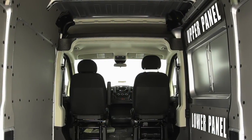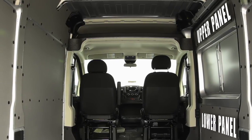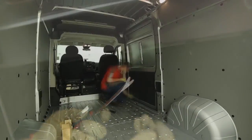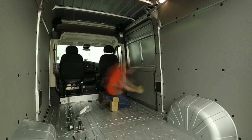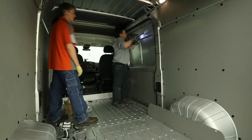There are two panels that install on the sliding door: a lower and an upper panel. There are factory-installed panels over the lower cavity in the door. Using a prying tool or a regular screwdriver, remove the factory-installed panel. The lower plastic panel has existing holes for all locations, so just position and pop in the larger thread fasteners. The upper panel requires drilling for all hole locations.